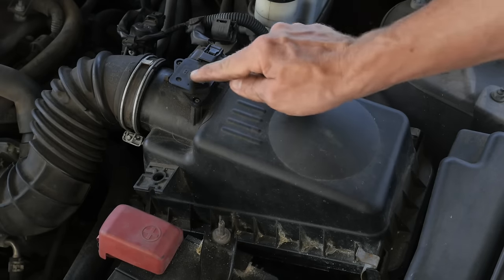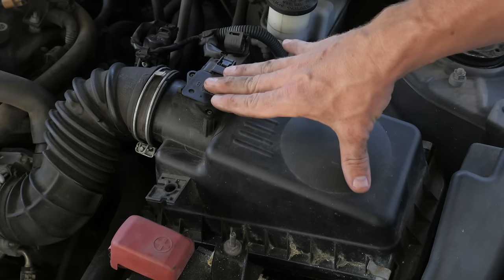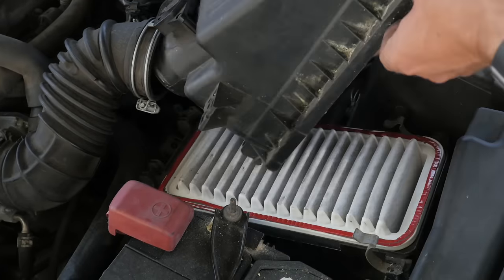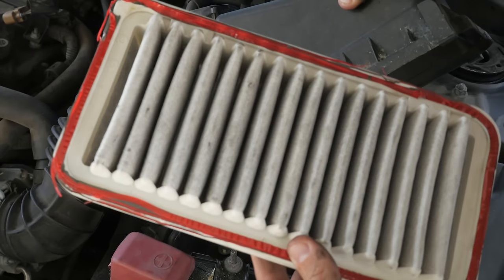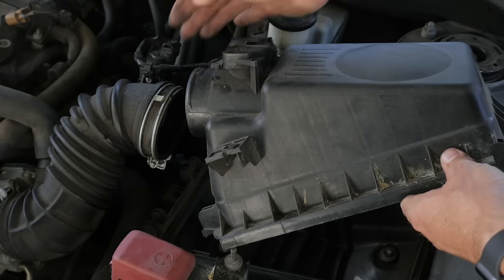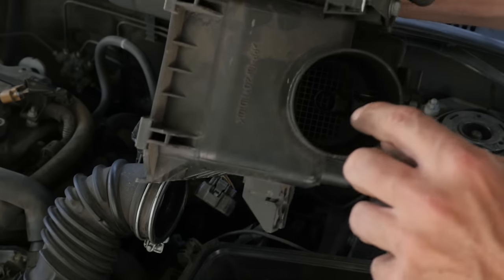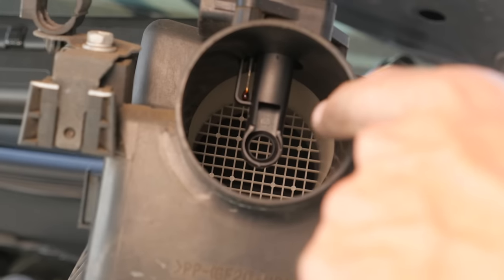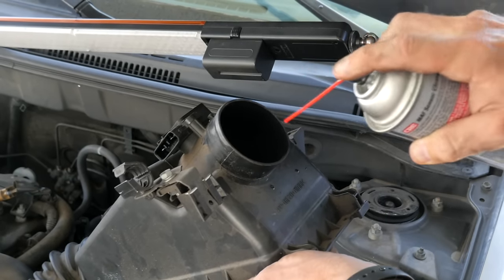A couple other elements of the air system: your air filter in the air box and your mass airflow sensor, which is usually on the air box or right at the head of the intake tube. You don't want to be running that throttle cleaner through those, which is why we sprayed it in the hose past this point. There's a special cleaner for the mass airflow sensor. Get your air box open and get your filter out — if it's really dirty it can affect your idle, but it'd be pretty unlikely. Unplug your mass airflow sensor to get a look at it. Don't stick anything in there, don't touch it, and don't spray anything except mass airflow sensor cleaner because there are really fragile wires and electronics. Just spray it in, let it dry, and put it back together.